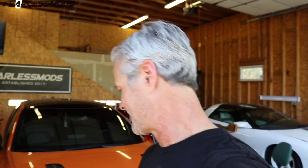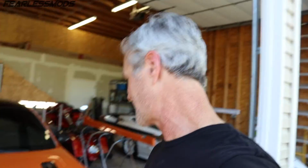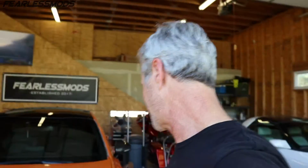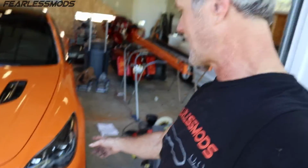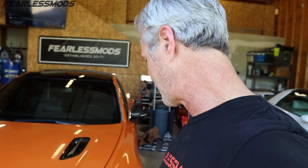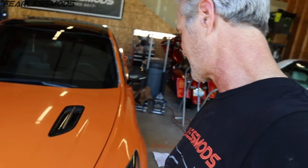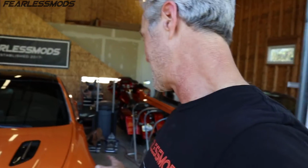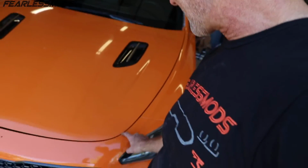Okay guys, I may not be the brightest guy working on cars. I just try to do what I can and put out YouTube videos for your enjoyment. But what I did was spend an entire day working to move this headlight essentially a quarter inch forward, thinking that the connection points for the bumper that attach above and below the headlight would then bring the bumper forward. But I failed to realize that it's actually the fender that it connects to, both top and bottom, that didn't move. And so, I mean, we moved it slightly, but not much. We just relieved some of the stress where it couldn't come forward because of the headlight. That allowed it to come forward just a smidge. And so we got a smidge of extra gap up here on this side.